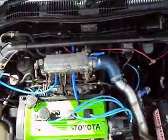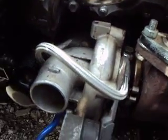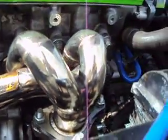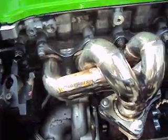I just want to show you a couple of areas which are actually a little bit more difficult to do than just by looking at this, because in particular the TD04 turbo — it doesn't come mounted in that direction. You'll notice on mine the inlet section is facing forward and you've got the braided oil feed on top. You'll have to actually get that turbo off and do something called rotating it.